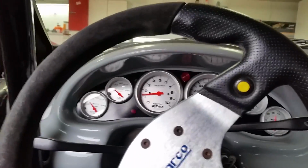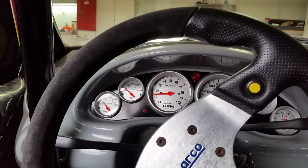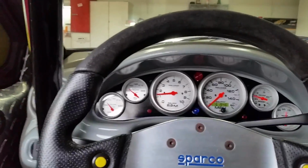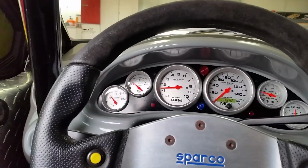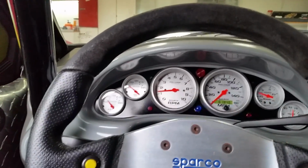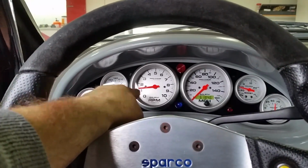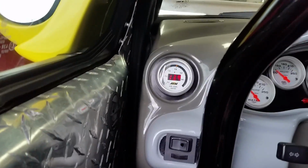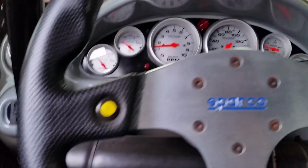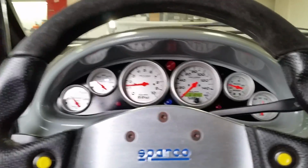Yeah, it's quite something tuning this thing. Getting it to start when it's cold, warm, hot is one of the hardest things to get right. I've never been able to get rid of the oscillation, you know, once it warms up. When it's cold, it idles mellow, and once it gets warm, it's whang. I get a lot of variation in my air fuel, and it makes the RPM go up and down. And I kind of just gave up on trying to fix it.